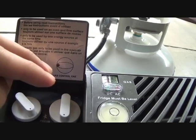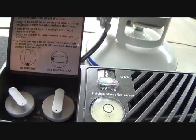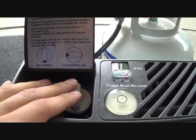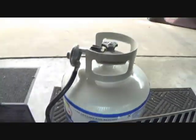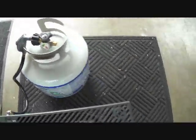It'll be facing this way — you hold it down for 20 seconds, then you'll twist it to where it is now. It'll click and it'll ignite the burner, then you hold it down for another 20 seconds after that click so it'll make sure the gas runs through the system. It takes a second, especially if you haven't plugged it in and the gas isn't in the lines. But after that, it starts up like a charm.